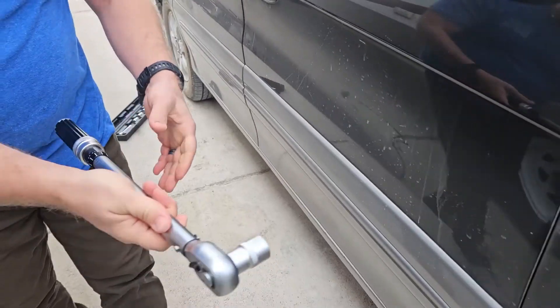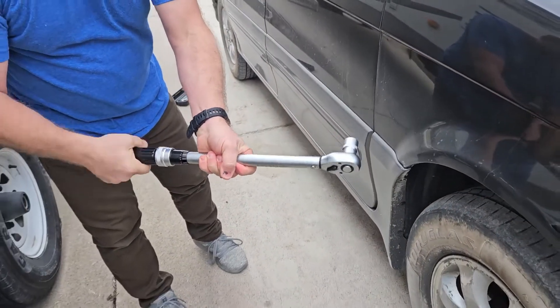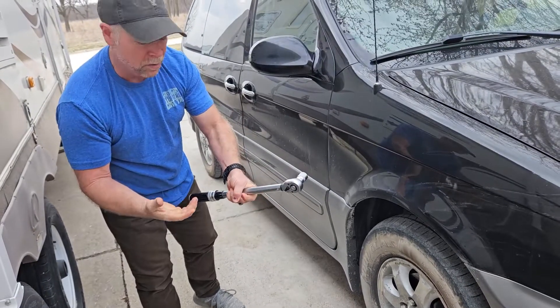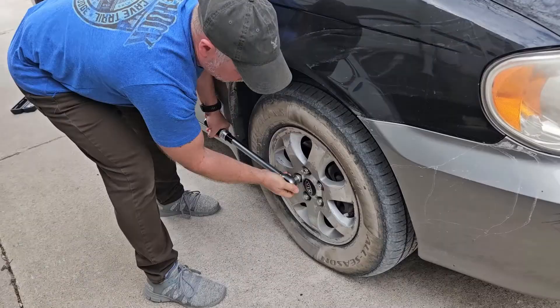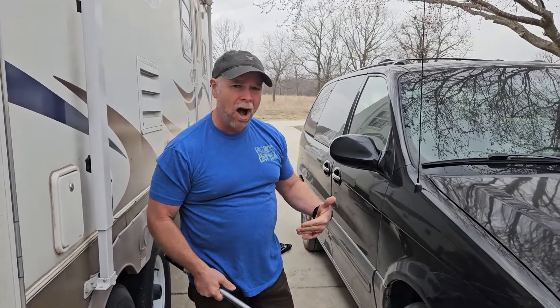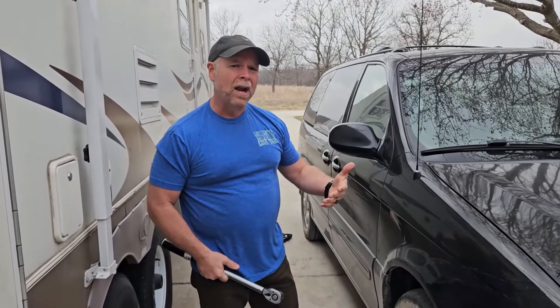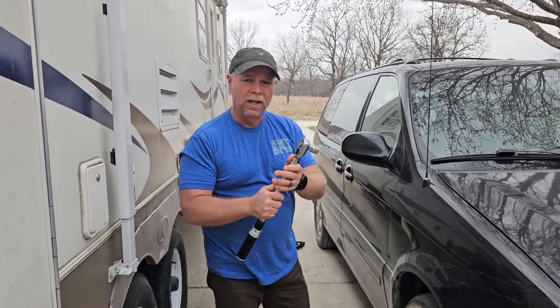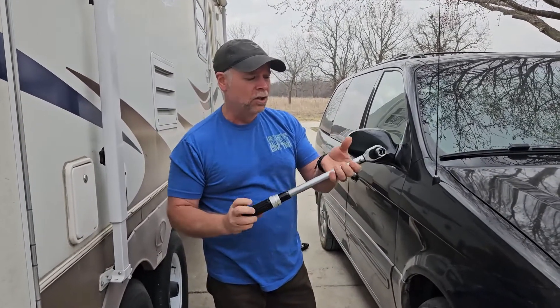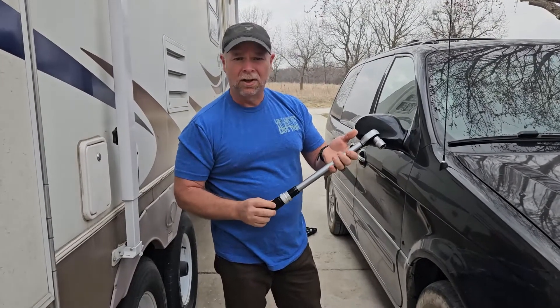We're going to check our front tire. Once it's locked in place it's not going to move — your ring will move but you won't adjust the foot-pounds or newton meters. It's really important that you have your lug nuts torqued to specs, and you want to check these on a regular basis, especially if you've taken your lug nuts off. After about 100 miles, go back and make sure they're re-torqued. You could go to a shop and have them do it, but if you've got your own torque wrench it's going to save you time, money, and headache.